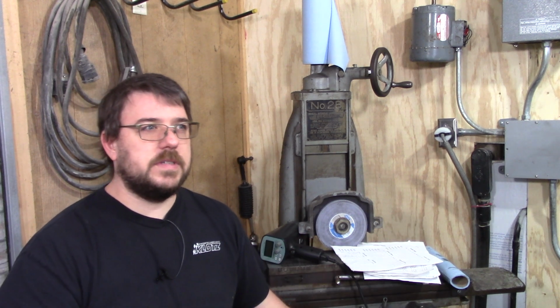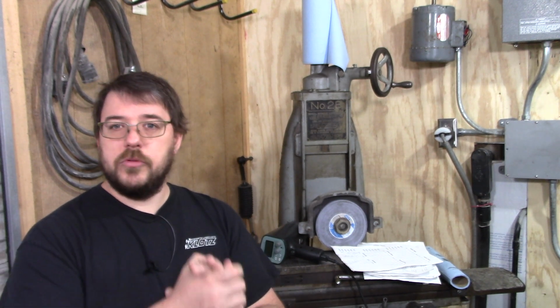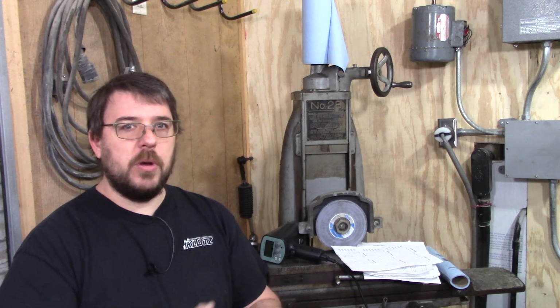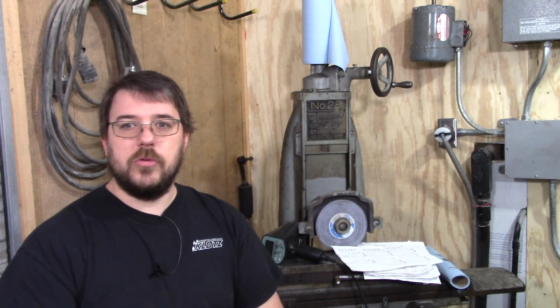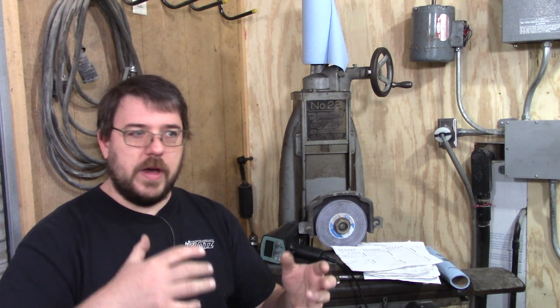So yeah, there's oil pressure missing, and the oil pressure will certainly try to make up for that, but I think that some people are going to be experiencing hydraulic lash adjuster collapsing, and that's why they're getting these issues. And they might also be explaining some of the issues with the balance and the misfires.